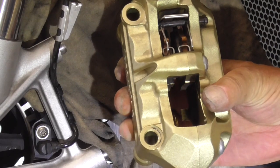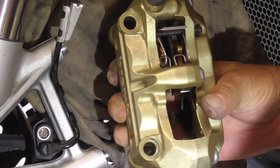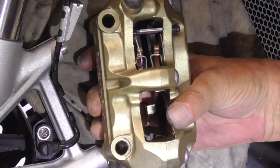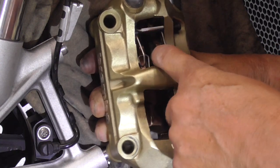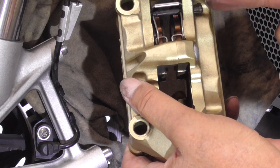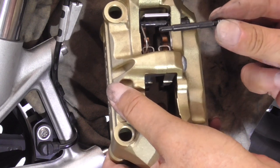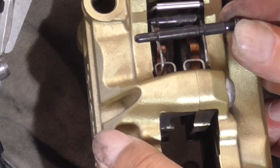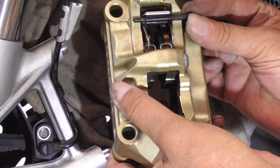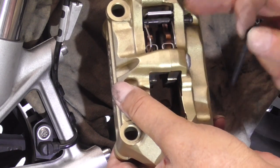Yes. Now watch. This is the upper side. You have to slide it underneath there and then it pushes onto the brake pads and then you have to push this all the way in and get that guiding pin in. But watch, that guiding pin has those slots. See, there is a thicker piece in the middle and it has to go like this, so it also prevents this pin from sliding out. It's blocking this pin.